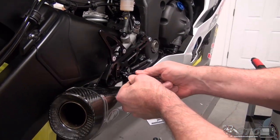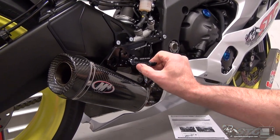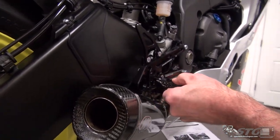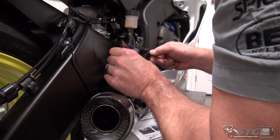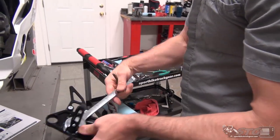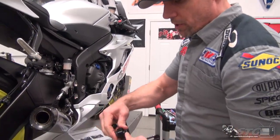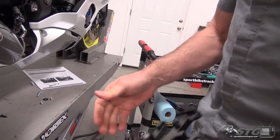Just loosely put the mounting bolts in there. I've got a 23mm wrench — rotate this until it looks really good, basically perpendicular with those locating marks. Go ahead and take it off and tighten it up, torque it down. If your preference is to use a torque wrench, go ahead and pull that out. There's a whole bunch of thread locker on there — I'm going to rinse that off before we install it. Next up we're going to put the exhaust mount grommet in there; the top hat spacer is going to hold that in.